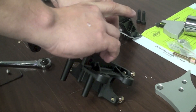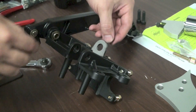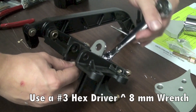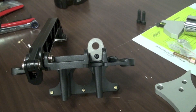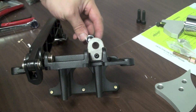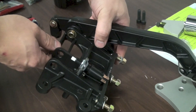With the hole now drilled in the pedal box, go ahead and take the number 10 screw, put it into place making sure that the bracket is closer to the pedal pivot. With that set, go ahead and put the brake light switch into place, taking note that you can adjust the brake light switch depth simply by adjusting the hex nuts and screwing the switch in or out, closer or further away from the pedal.